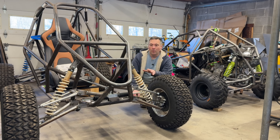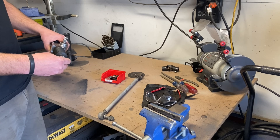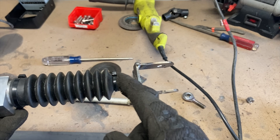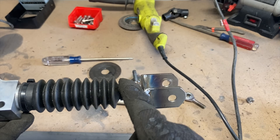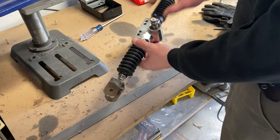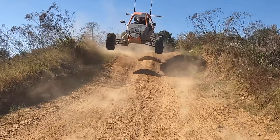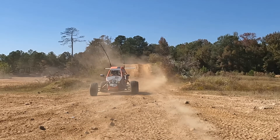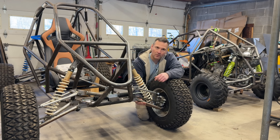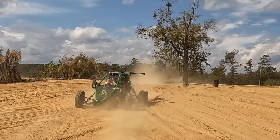Now the whole thing with these steering racks — I use extended bolts, I remove the eye bolts from the ends, and I make it so you have adjustable bump steer. The geometry of bump steer can be complex, but if you make an adjustable rack you can tune out all bump steer. It's a pretty cool setup and it's worked really well, but there are some guys putting more ground clearance on their carts and increasing the angle of their A-arms.